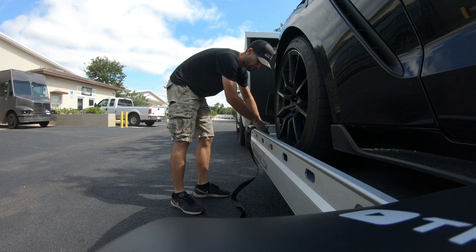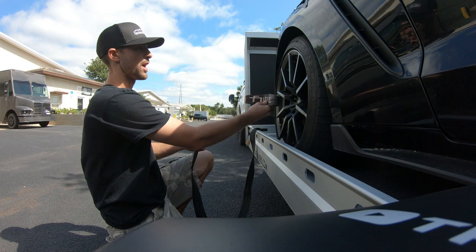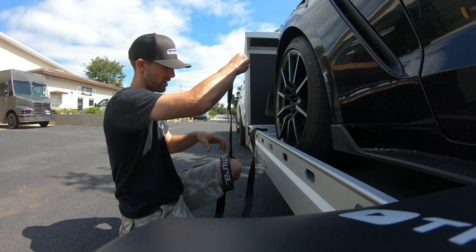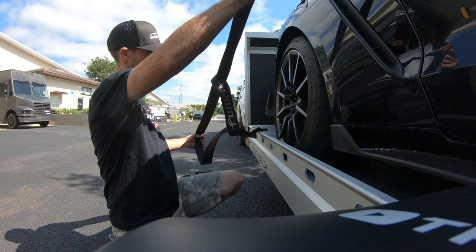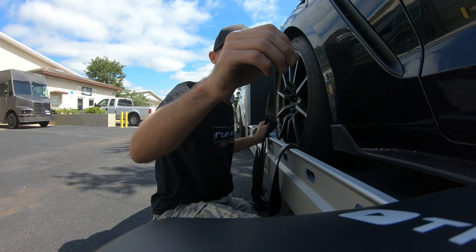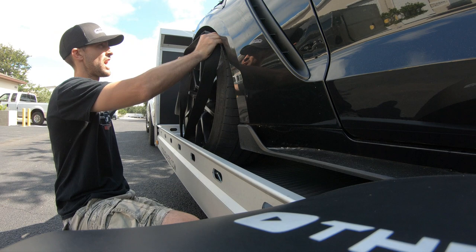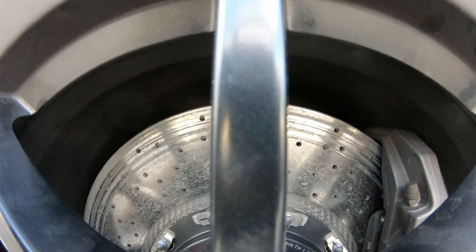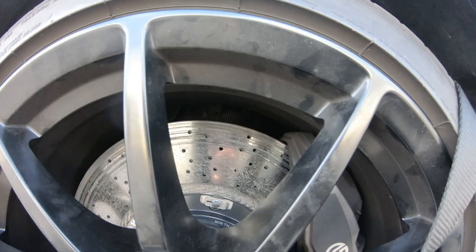On the driver's side, the strap sits right here in the wheel. The restraining strap goes through the bottom of the strap and back down through the other side, so what you end up with is basically a loop. Go ahead and hook the tie-down hook and loop it into the D-ring, then work the strap over the tire to the back side — to where you can see the strap between the wheel and the suspension. You want this to be as level as possible.